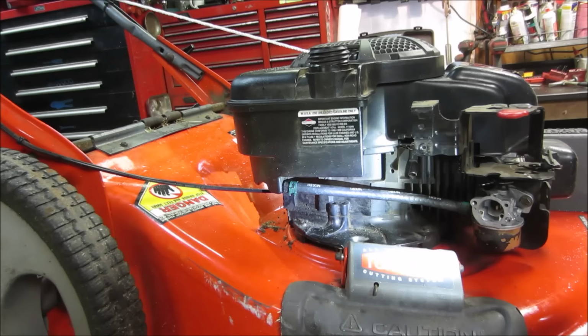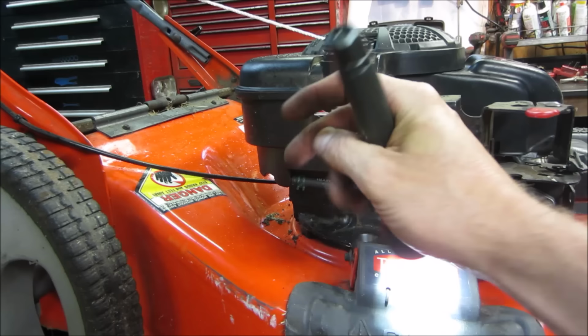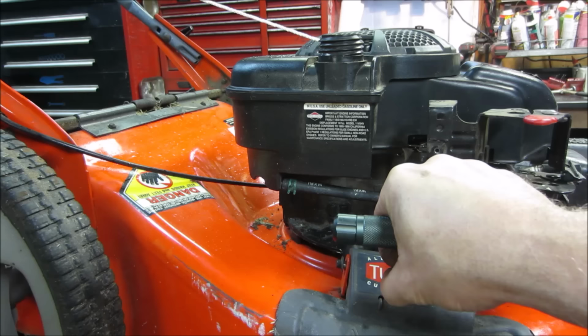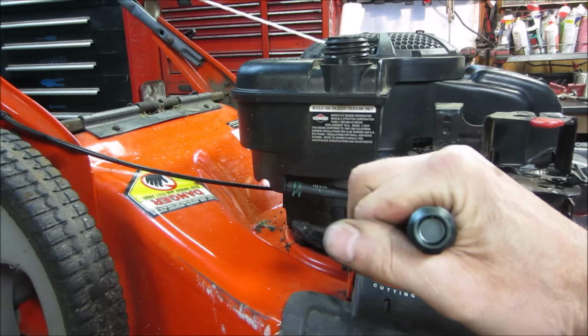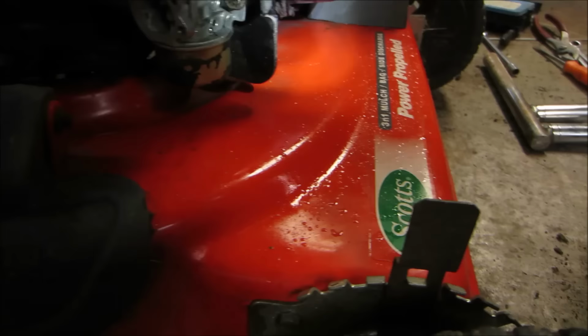These are spring-loaded clamps. They're not like a threaded down clamp. I actually prefer these better, but if it's got an old footprint of where the barbs were sitting on it before and it was clamped down, you take it off and put it back on, if you're not where that barb was, it could have a little bit of play around. It's not crushed down on the center of it, I think is what was happening. I don't see anything now. I blew it off with air, put more gas in it. Probably the other side. You can see on the deck where it washed down.